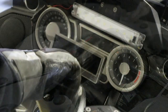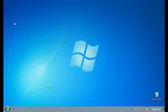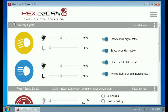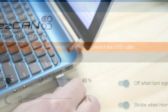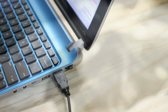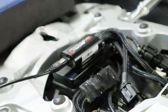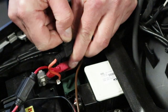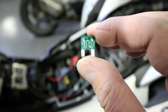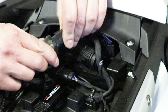Turn on the motorcycle's ignition switch. Launch the EZ-Can software on your computer. You will see the Hex EZ-Can configuration tool. If the disconnection error message appears, make sure the USB cable is securely seated in both the computer and EZ-Can USB ports, make sure the EZ-Can is receiving power from the battery, make sure the EZ-Can fuse is not blown, and make sure the EZ-Can is properly connected to both of the motorcycle's CAN bus connectors.